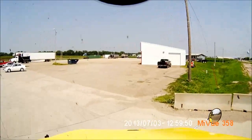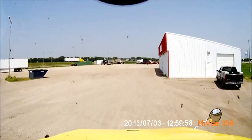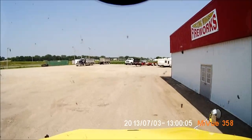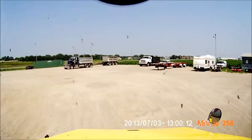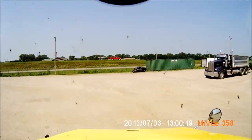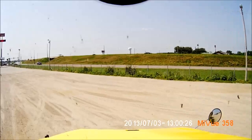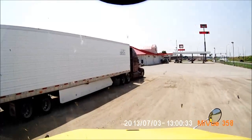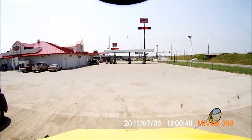Benefit of my bigger tires, because now they spin at 492 revs per mile, so my cruising speed now is 100 kilometers an hour, or just over 62 miles per hour, and that really helps when you need to cover some serious distance. Sometimes I do 65 now, but then my RPM is like 1400. No, I don't like that. But 62, 100k an hour, that puts me at 1330 RPM, which is very close to what CAT recommends for best fuel economy. They actually say 1325.